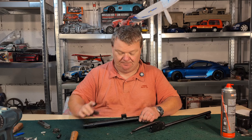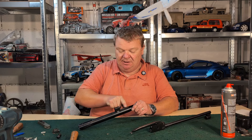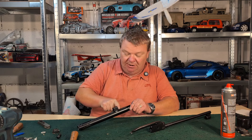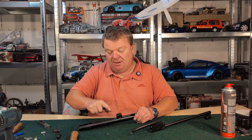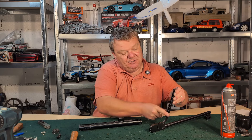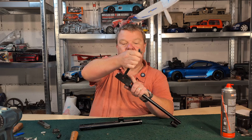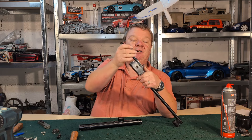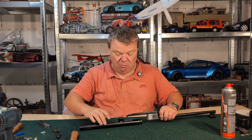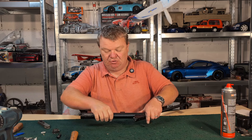You'll see where it's been rubbing on the metalwork as it goes backwards and forwards cocking. You've got a tunnel which stops you getting through to that bit — don't worry, just put some either side of it and it'll work its way in. And maybe what's left on your finger, just give it a rub there. Also, this knuckle joint here, similar to the HW-50 and HW-99, can be very tight — just loosen that up and then it will work a nicer way.